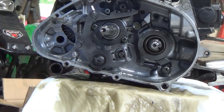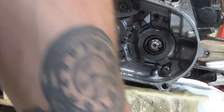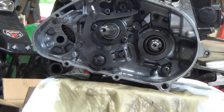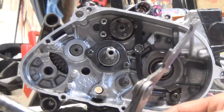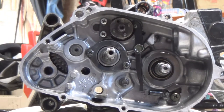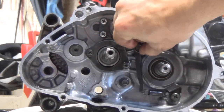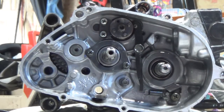It's just a piece of wire wrapped in the groove — kind of genius, but definitely not the right thing. Battery died but we got the shift mechanism off, pretty straightforward. Next thing we're gonna get is the stopper lever — the shoulder bolt comes out, pull that out, and then you can pull that lever out.